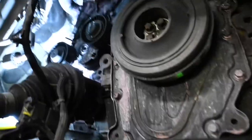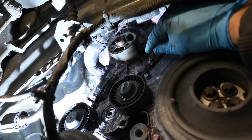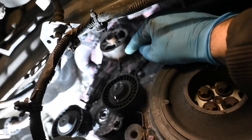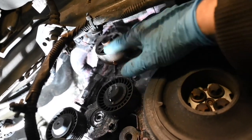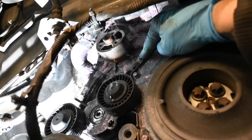I'm going to take the water pump off along with the pulley, marry the two up, and show you exactly what to look out for. This is going quite well and more straightforward than I thought. The water pump looks a bit different now because I've just removed the actual pulley, which is bolted to the outside of the impeller with three 10mm bolts — they come off quite easily. Once you've removed the pulley, it gives you a lot more access to the bolts that hold in the water pump — six 8mm bolts.